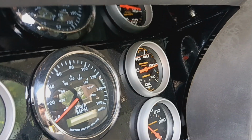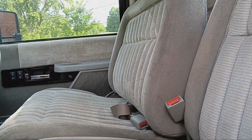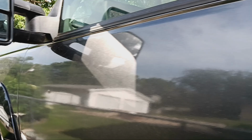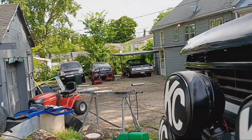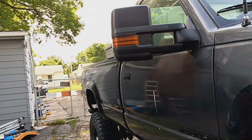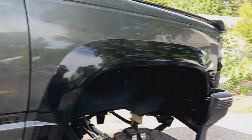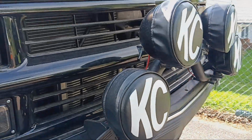And it's got plenty of oil pressure. Give it enough throttle, it'll make the belt squeal. But as you can see, there's no more valve train noise. And the machine shop, he was like, 120 and 310. He said they shouldn't be losing contact with the cam. Well, they were losing contact with the cam, because that noise is gone. And I know that noise. I've experienced it before.